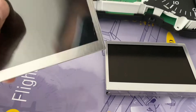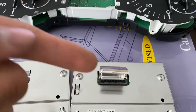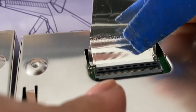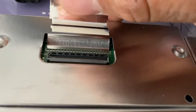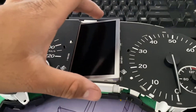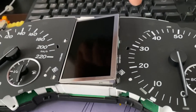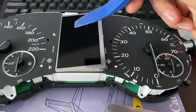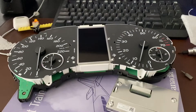What we do have to do is get underneath this one and pop the cable out just like we did on the other side — it's kind of like a lever that comes up. The lever comes up and then you take the ribbon cable and pull it out. Then we're going to reinstall it on the new one. The display is reinstalled with the ribbon cable. You want to put the display in like that, then peel the sheathing up again and push the display in. The idea is to get it locked in on one side first, pull the black plastic up, and get the display underneath it. Screen's installed.